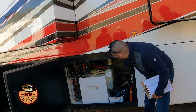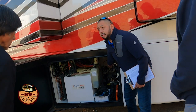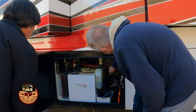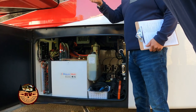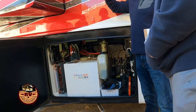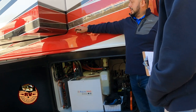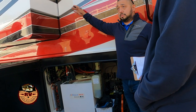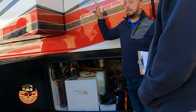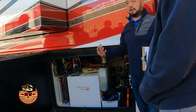If you look on that back wall there, you'll see what we call air manifolds. That's on that very back wall, and there's a T-handle that goes into it. So what you want to do is just close that valve, and now it doesn't necessarily deflate your air bladder. It just drops it to atmospheric pressure. It won't suck it back in. It doesn't suck it out.